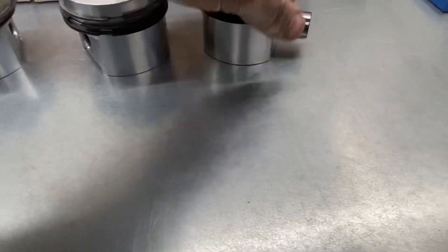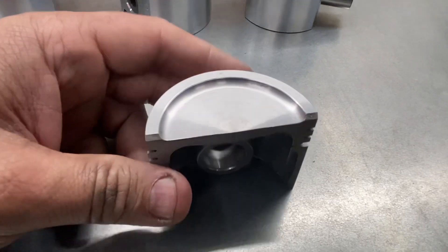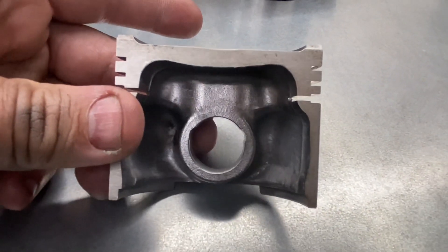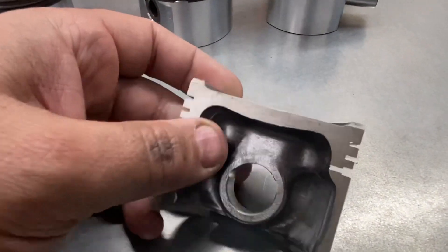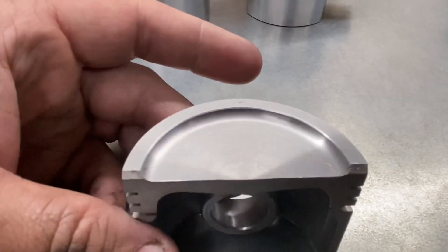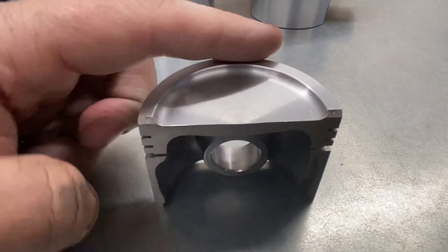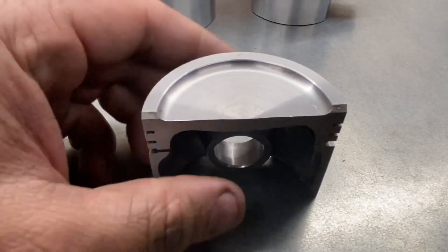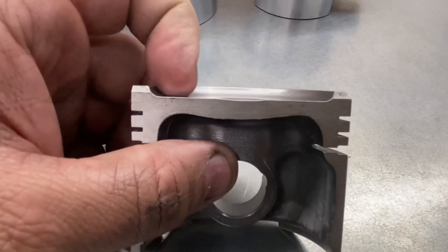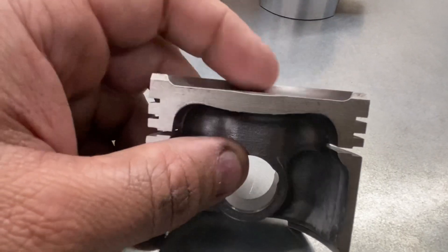Now the other thing that needs to be answered is that some people think about the weakening of the piston if you machine a bit off the top. So here is a cutaway version — this is a brand new 21253, a plus 20 or a plus 40. This particular piston has had about 88 thousandths machined off the crown and then the dish re-established, so that piston dish there is now about 8cc or about 8.5cc.